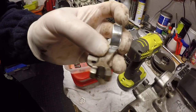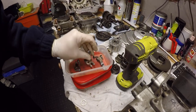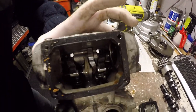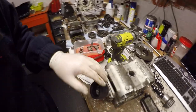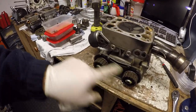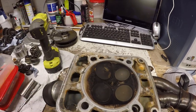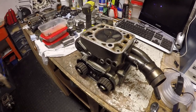On the closing arm, again some wear but not broken through. I'll look through my spares to see if I've got slightly better condition arms to put back in, but there's nothing there that really particularly worries me — you'd get another season's worth of running out of that. Now the vertical head — I'm going to pop off both the cams and cam covers and have a look at the rockers as well. Same thing again, it's going to need a good cleanup, valves being relapped, etc. — everything else is pretty much a given.